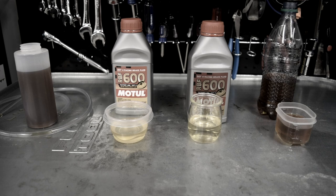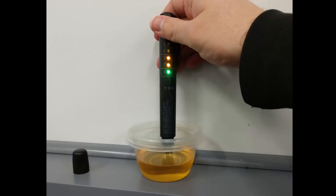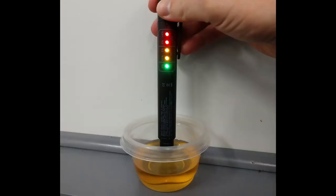I'm interrupting myself to bring some instant gratification. You'll recall I said in some future video I'd have an update about the brake fluid I was leaving out. Well — here is a reading taken just about 48 hours after I recorded the original video, and here is another taken after about 72 hours. What this tells me is it's of vital importance to properly store brake fluid, and to make sure your master cylinder seals appropriately, because brake fluid left open to the air — even in a climate-controlled garage — will effectively spoil inside of a week.